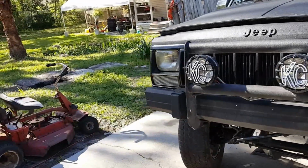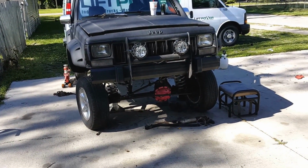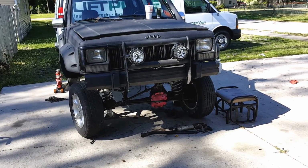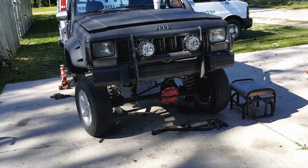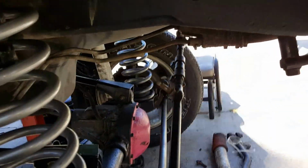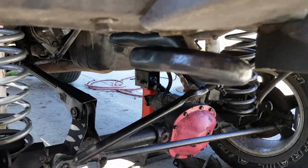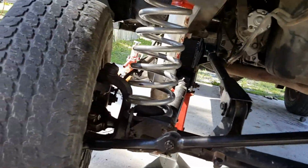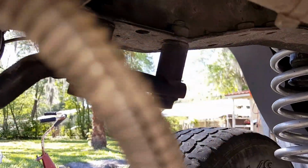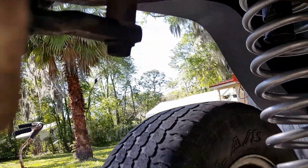Also, these Jeeps, another cheap deal that I found. I like cheap. There's nowhere to pull from these things on the front if you don't have an aftermarket bumper. Not really, anyway. I mean, you can get those aftermarket hooks, but I found this one in a junkyard, and we ran it like that. I don't know if you can see it the way the sun is. Let me get on this side of it. There it is. It comes out the bottom right there, but it mounts. I mounted it right up there like that. You see that? Some grade 8 bolts screwed through there.